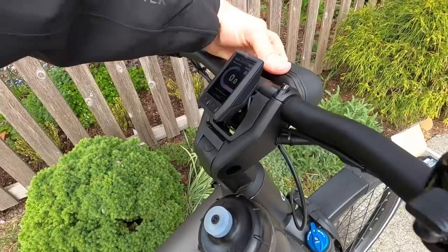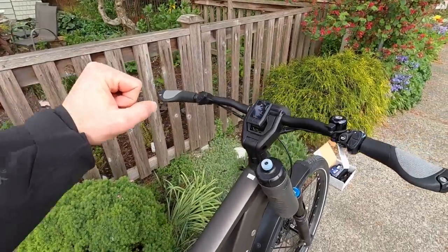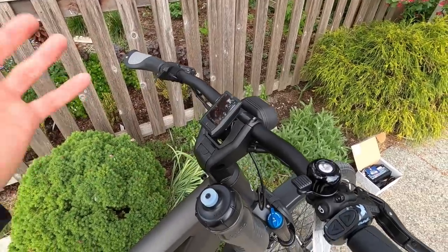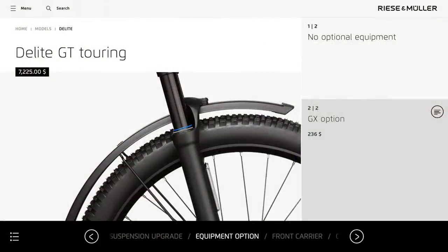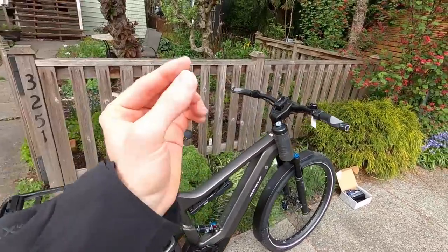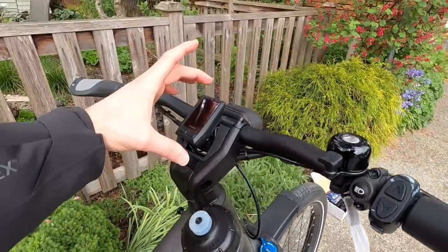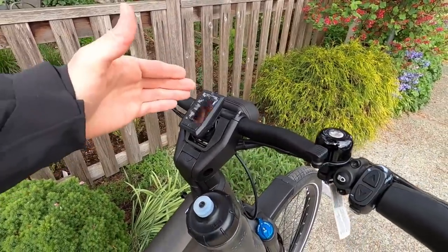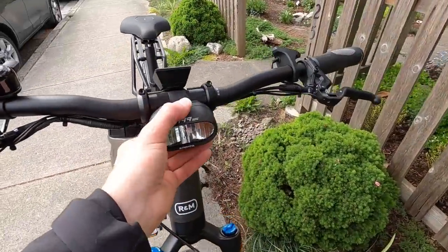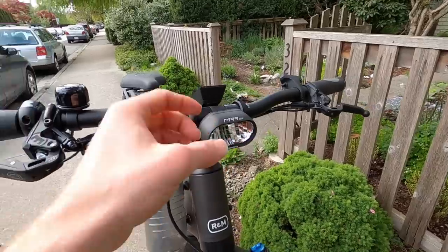I was concerned about the adjustable angle — this is a custom Ergotech stem, very sturdy and beefy, and it lets you raise the handlebar. It has a smaller clamp diameter than expected: 25.4mm versus 31.8mm on many mountain bike setups. They've also put the Bosch Kiox display here as an upgrade. If you aim the headlight, it could affect the display angle — but they engineered a solution: the light and display share a pivot point so you can aim the light independently. Just awesome engineering.